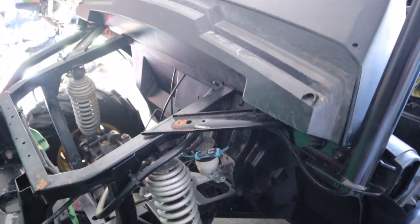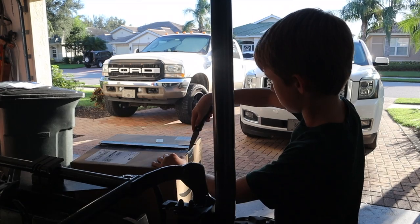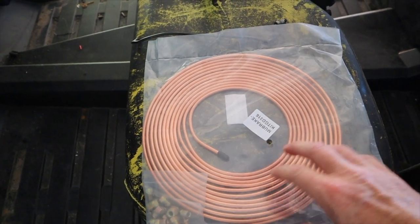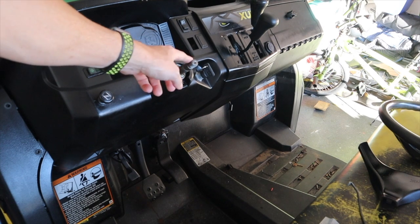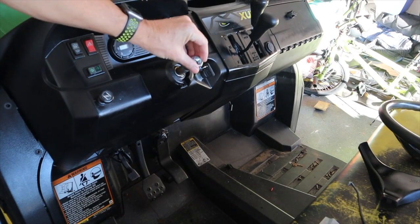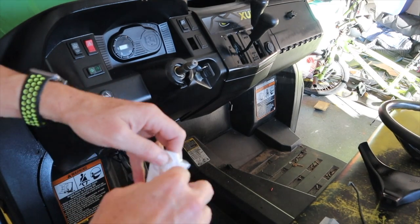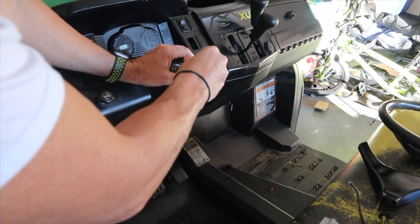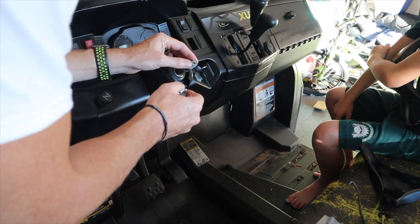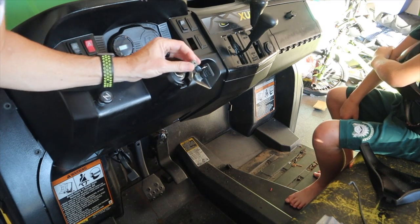So I bought some more tubing, and I'm pretty sure that's what just got delivered. This is the new tubing. Since it was missing the steering column nut, I went to the store and tried to guess the size. I got one of each - a standard and a metric. Standard didn't work, so let's hope the metric works. It may actually be the right size, but I've noticed I may have messed up the threads trying to get the steering wheel off. So I'm going to see if I can clean up the threads.